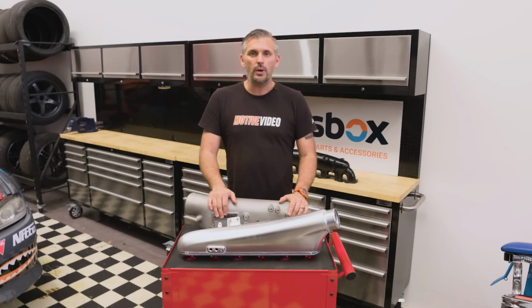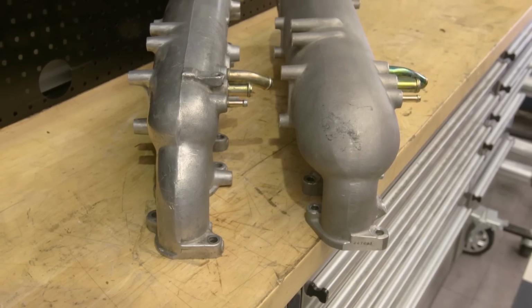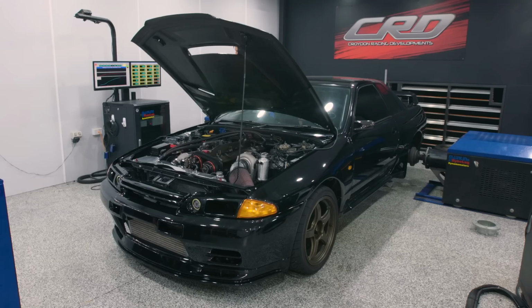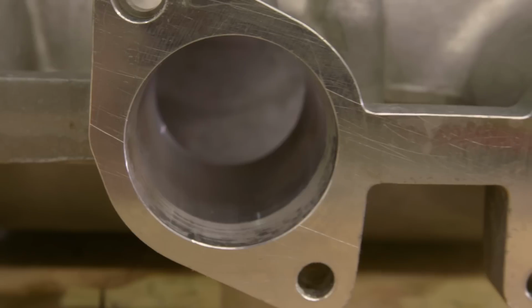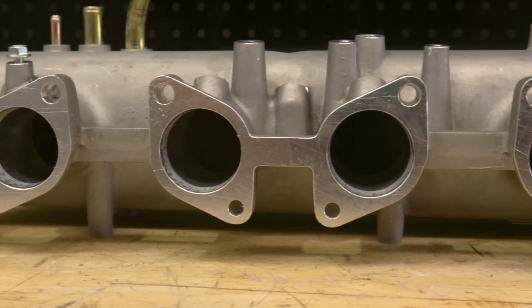Now, if you're a regular viewer of our channel, you would have seen our OEM versus Nismo RB26 intake collector video, and I will be perfectly honest, I was very surprised at how good the Nismo inlet was. I was expecting it to be more about low down and mid-range torque, but it had more low down and more top end, and a very well designed and very well thought out inlet collector for the RB26.